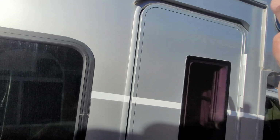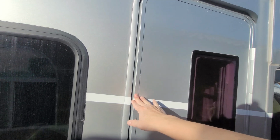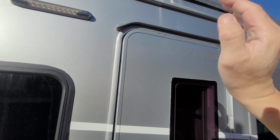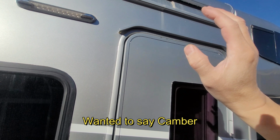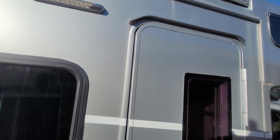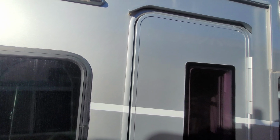And on top of it, I think if the manufacturer made this tolerance a little bit smaller, as well as the door manufacturer, if they put a load on this door, I think some of your structural engineers will know, but when this is latched, this door still likes to flex. So if they put a little bit of a preload where it's more like cup shaped, it would suck onto that door much better. So let's go ahead and show you what I do.